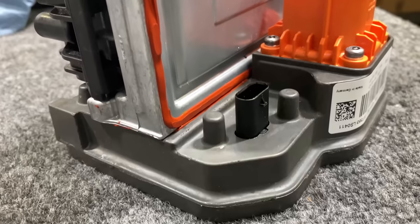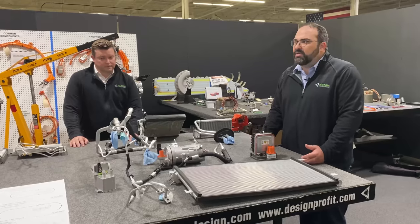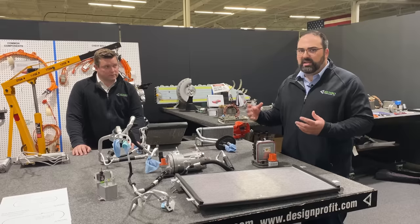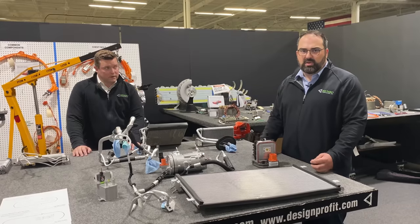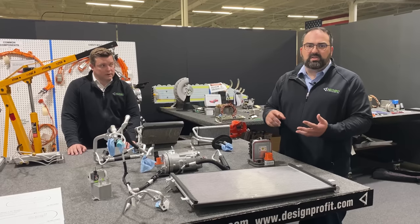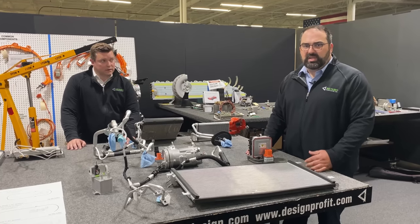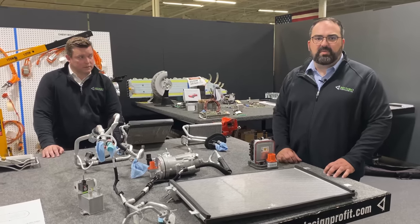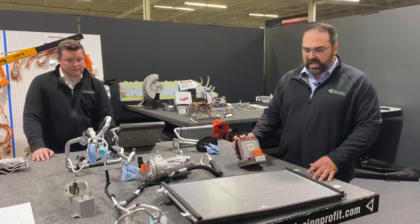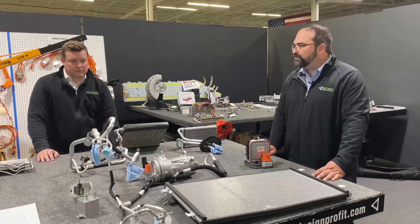And this is something that is very similar to what was done in traditional ICE engines. When you have a gasoline or a diesel engine, they are 30 to 35% efficient. They're not real efficient in turning the energy that's stored in the fuel into power to drive down the street. There's a lot of noise, heat, and vibration created in that process. So in an ICE vehicle, you take the heat that is essentially waste from the engine and you turn that into heat in the cabin. So they are replacing the engine heat with the PTC heater in the Mach-E thermal system.